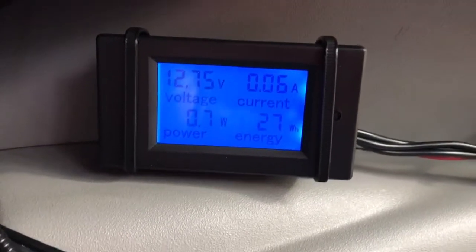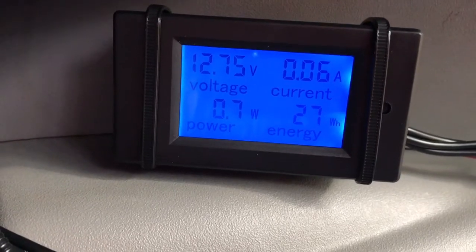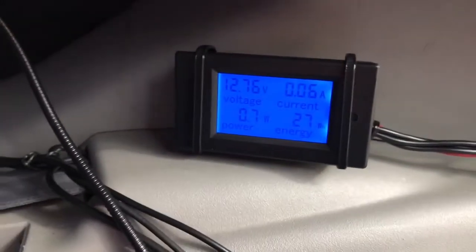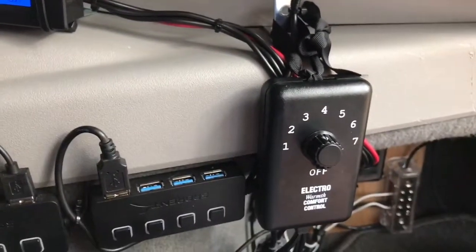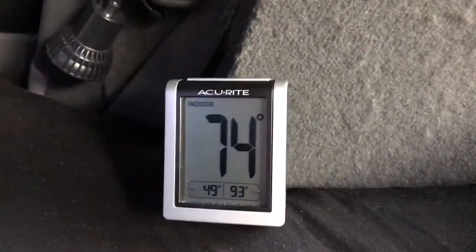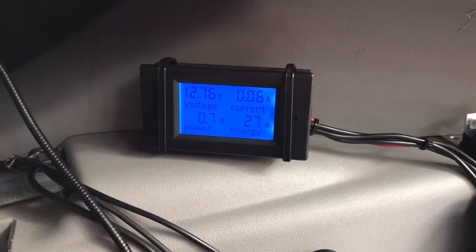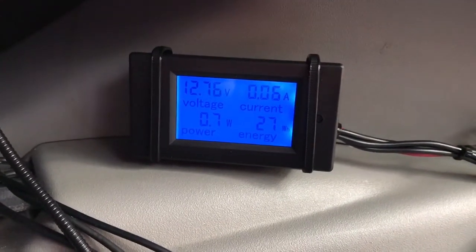Here are the final numbers: it ran for four hours and used 27 watt hours, which is basically 2 amp-hours over four hours — so 0.5 amps per hour on average. That's amazing. What I've learned is: lighting with a lot of LEDs can use significant power; the refrigerator is not a problem at all; the one to watch is the electric blanket. I'll need to track that overnight. Temperature in the car today varied from about 65 to 93°F. I hope you enjoyed the video — if you're into tracking energy usage, it's kind of interesting. Thanks for watching!